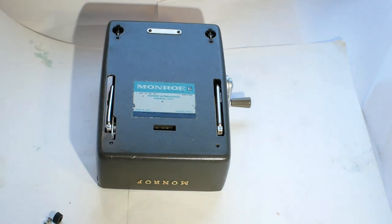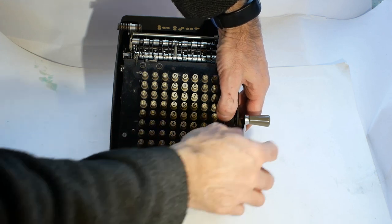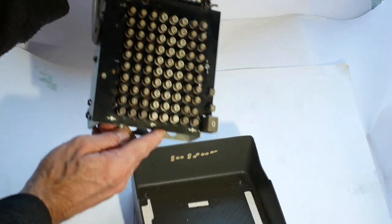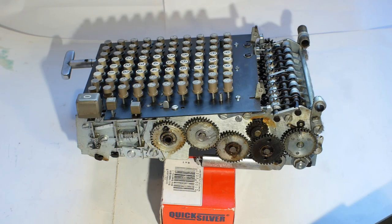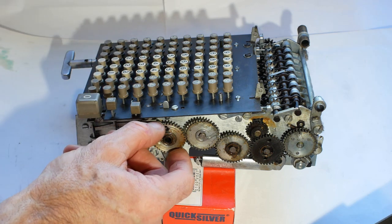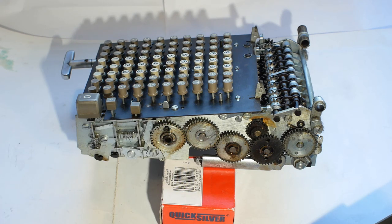The handle will have to come off first. So with the four screws removed from the underside, there's a little release lever here that allows you to take the handle out, and then I should be able to remove the mechanism from the case. First glance at the mechanism and there's brown gungy old oil on the shaft of the handle, and all these drive gears are really solid with old dried oil and grease. So my first job is going to be to go through the machine, clean out the old oil, and replace it with fresh stuff.